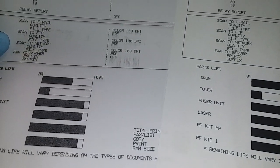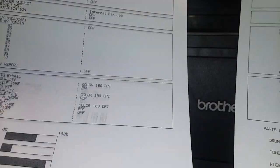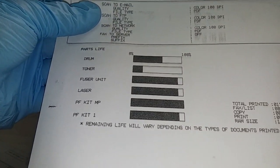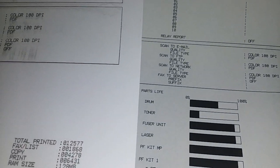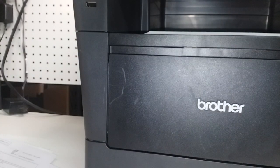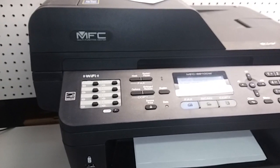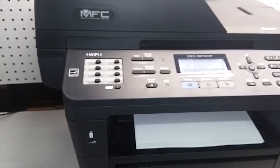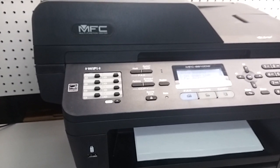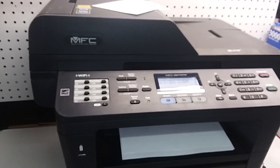You can see that is the same printer according to the serial number — that we changed the fuser on. You can see the smudges on the old one, and this is what it looks like right now. This is a great printout, very good. I'm not sure how long this is going to keep going at good quality, but we definitely solved the problem for now. It's best to just change out the fuser sleeves and rollers, but at least now you know how to do that. Hopefully I was able to help — subscribe, like the video, and hopefully I can give you more tips in the future. Thank you.